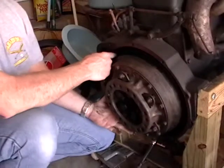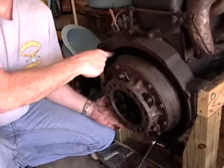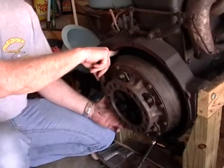And that automatically disengages this. And this is what happens if you keep trying to start it, it keeps sucking this into that wheel because now it's slowed down. And you hear that's like the teeth getting all ground up on there. So it's bad.